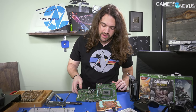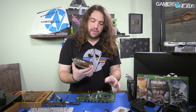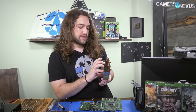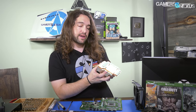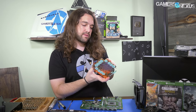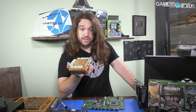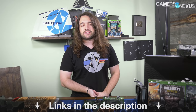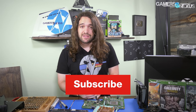That's pretty much it for the teardown. A couple small things like a PC speaker. The vapor chamber has a copper plate on the bottom, aluminum fins on top, and a separate aluminum plate contacting the VRM components that sinks into the fin stack — not directly into the copper vapor chamber section. The Xbox One X is not too hard to take apart; the only trick is popping the retention clip off the back. We're going to rebuild it now. Subscribe for more, check out store.gamersnexus.net for shirts and stickers, and patreon.com/gamersnexus to help us out directly.